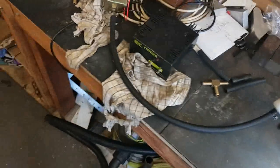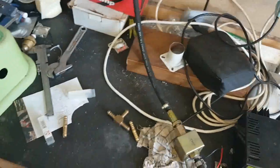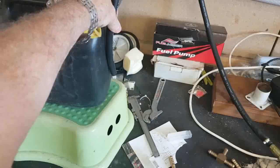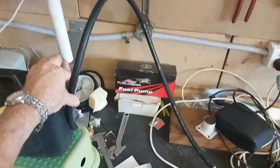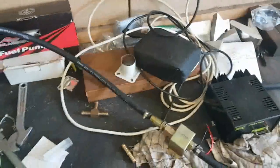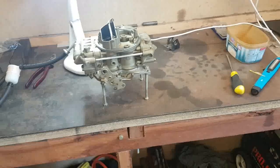What I've done is set up a fuel pump here, and I'm going to put a T-intersection in here because I need to prime the fuel pump. I got a mouthful of petrol the other day and I don't want to repeat that, so I'm jerry-rigging a system to put the fuel line into the petrol container and pull up some fuel to get it primed. I've also got a little vacuum pump normally used for bleeding brakes — I'm hoping that by putting that on and pumping it I can prime it without getting mouthfuls of petrol. I'll finish setting that up and get back.